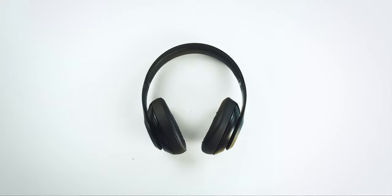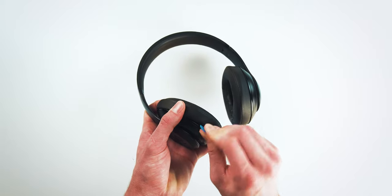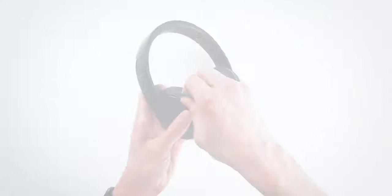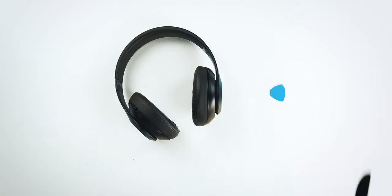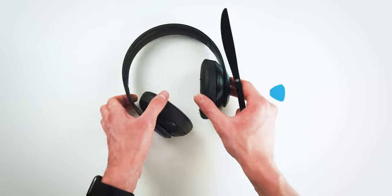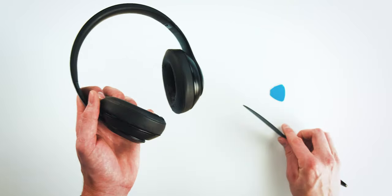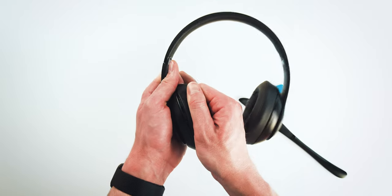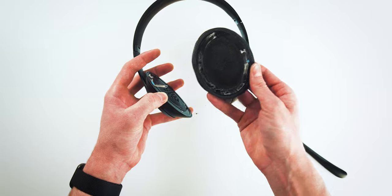Here's a pair of Studio headphones, and the first thing we have to do is separate the ear cups from the rest of the headphone frame. To do that, our ear cup removal kit comes with some kind of pry tool — this one came with a triangular one — and we're going to insert it in between the area where the headphones meet the ear cups. Your goal is to carefully and slowly separate the ear cups from the headphone frame. Sometimes the pry tool that comes with the kit is not the best choice — as you can see here, I actually chipped off the corner — so instead I'm going to use a dull kitchen knife. I'm carefully inserting the knife into that seal between the ear cups and the headphones, slowly breaking away the adhesive ring below the ear cup. After a little bit of work, you will start to feel the ear cups separate, and from that point you can just pull the two apart and peel the ear cup off.